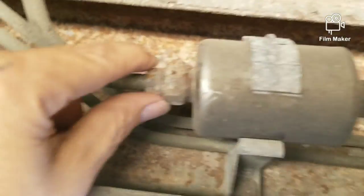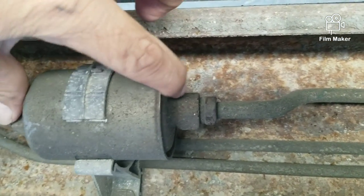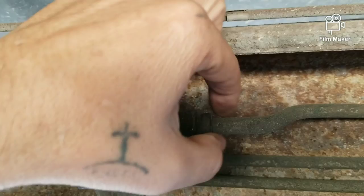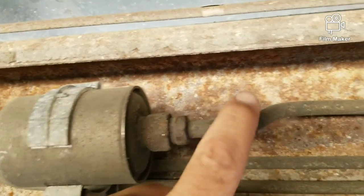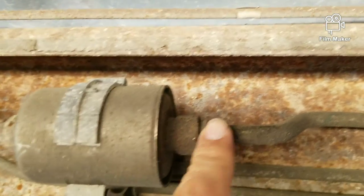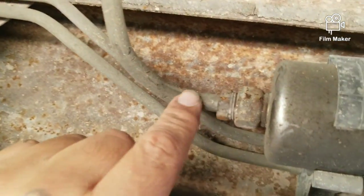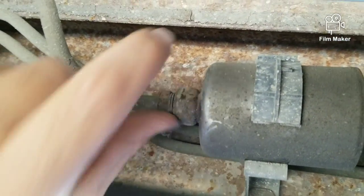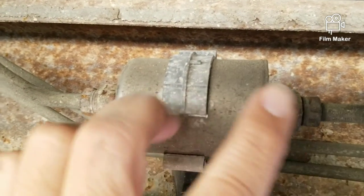Okay, let's go back and see the whole thing. There are two fittings right here and two right here — they're one whole unit. You're gonna put one wrench here to hold it steady so you can twist this one. Don't just start twisting the little one trying to take it off, because you'll end up bending stuff and you're gonna be in a lot of trouble — you'll have to replace lines. Same thing on this side: put a wrench here to hold it so when you twist, the whole thing isn't twisting and busting stuff up.